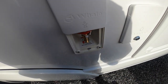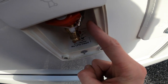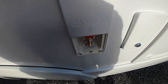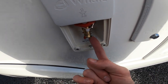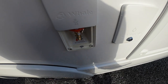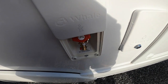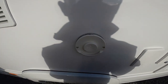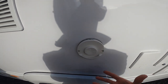You've got your external gas point here, which runs off the bottles on board. You've got your spigot — that needs cut off and you need some gas hosing, which is the orange rubber hosing, and a jubilee clip to connect that to the hose and then onto the gas appliance, such as a caddy gas heater. You can then turn the gas on and off from the gas tap. There is a Truma vent for the fumes, which just allows the nasties out from the heating and hot water system.